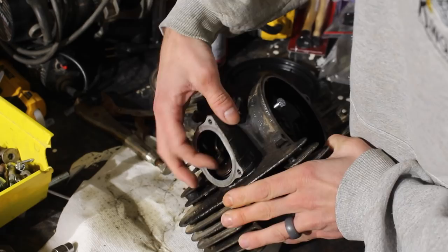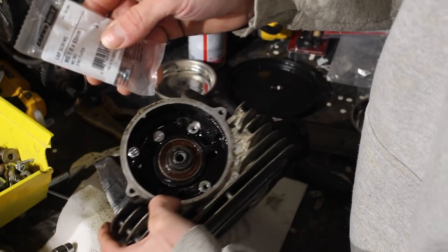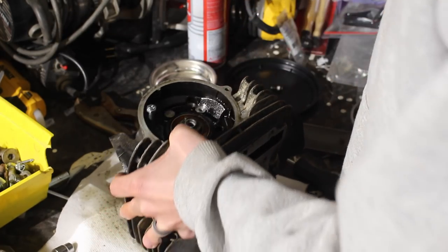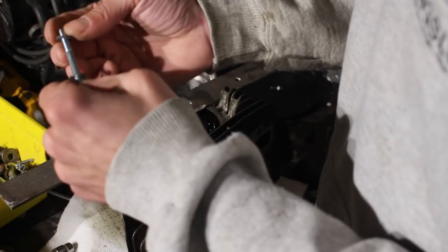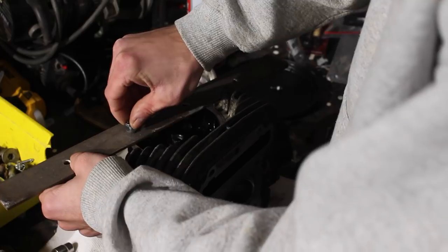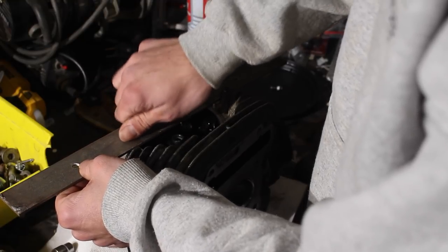Alright, so we've got to pull out these rocker arms. The shaft for them is located here and here. It's threaded, it's metric. It's a metric 6 1.0. And these are at Home Depot, 60 millimeters are the longest ones you can get. So what we're gonna do is put a plate here and try to jack them out that way. I'm gonna put two washers on here to kind of act like a thrust bearing. Give us a little spin on there. And I got some other plans if this doesn't work, but we'll see if it pulls it out.